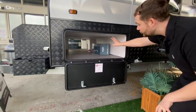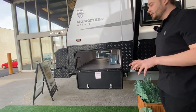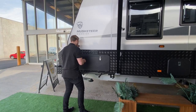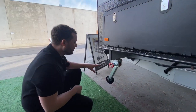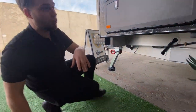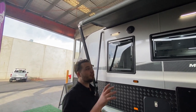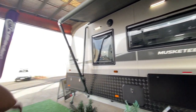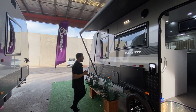There's full storage all the way through. That's our jack and DO35 coupling, with awning pull-out rails and hardware. Wind-down jockey wheel clamps, suction-tight boots that lock away. We've got Alco drop-down stabiliser legs — European product, very solid, backed by Alco's national warranty. There's an outside cooking point, and we've got a 16-foot splashed granite Dometic awning with black awning arms for a bit of flair. It rolls back up to grey canvas, really easy to wipe over.